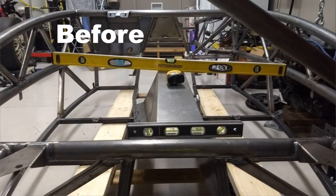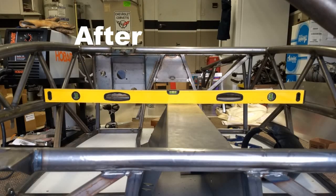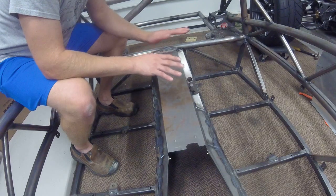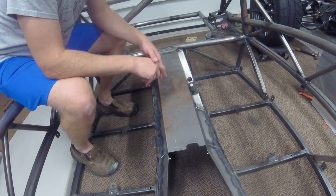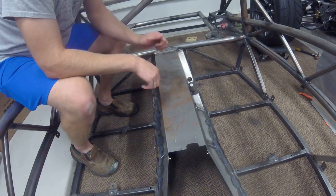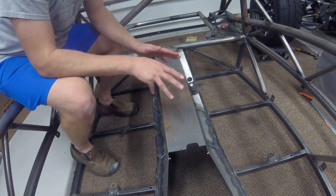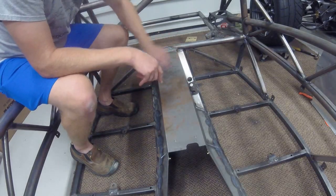The transmission tunnel on mine came in very poorly fabricated and welded — completely unacceptable. I worked it out with Kevin at X-Motive, had a new trans tunnel shipped out, and he paid for labor. When I got it in, it was fairly easy to make right, so I went ahead and welded most of it up myself once I ensured fit. I also had to cut out some floor tubes — the floor was about a half inch out of flat, not true from the driver's side to the passenger's side. Those tubes had to be bent back into line and welded in on a jig to make everything true and flat.